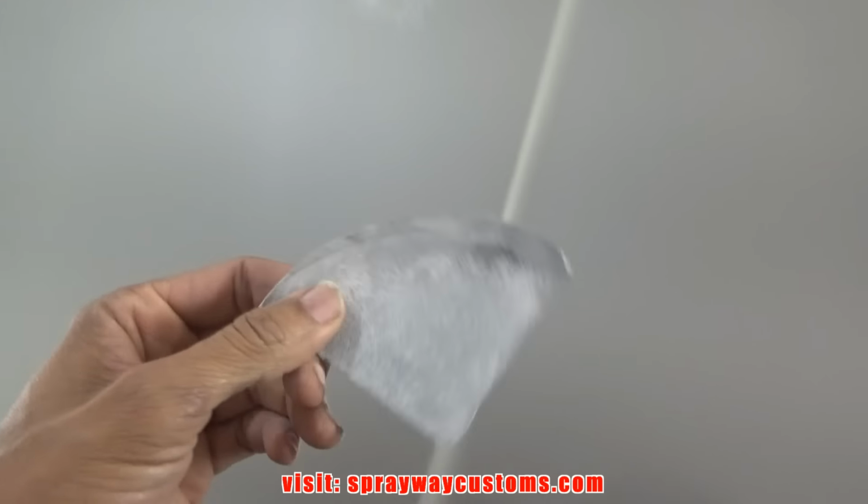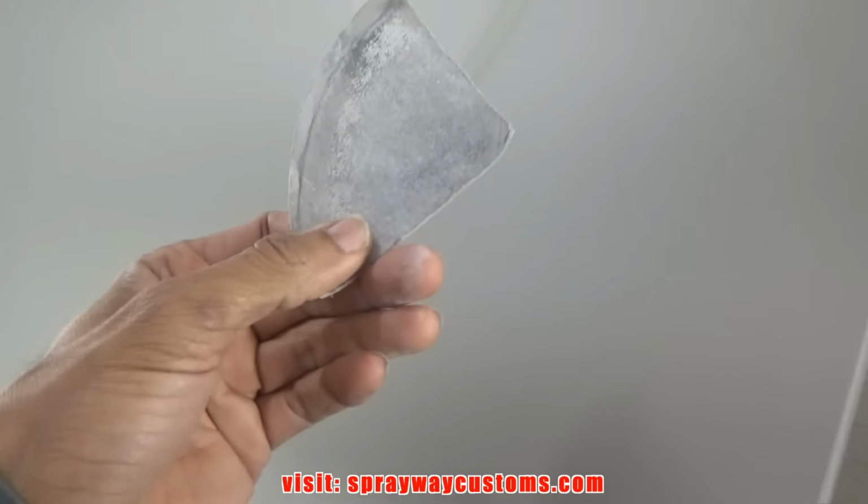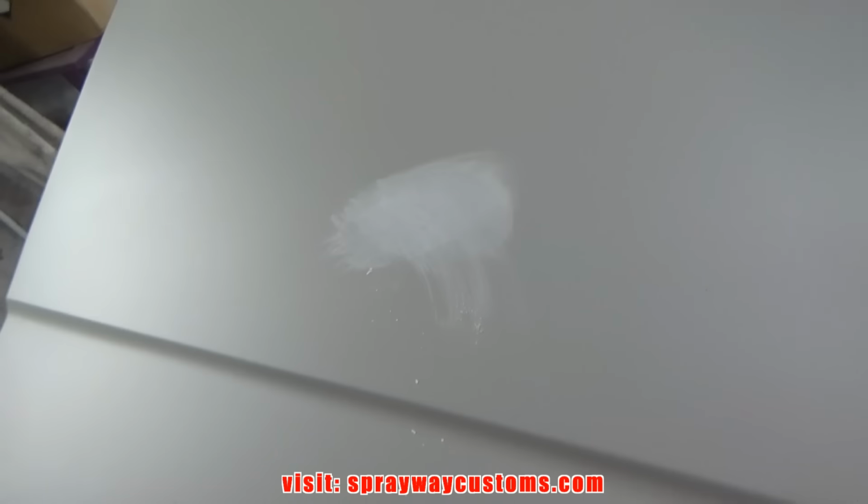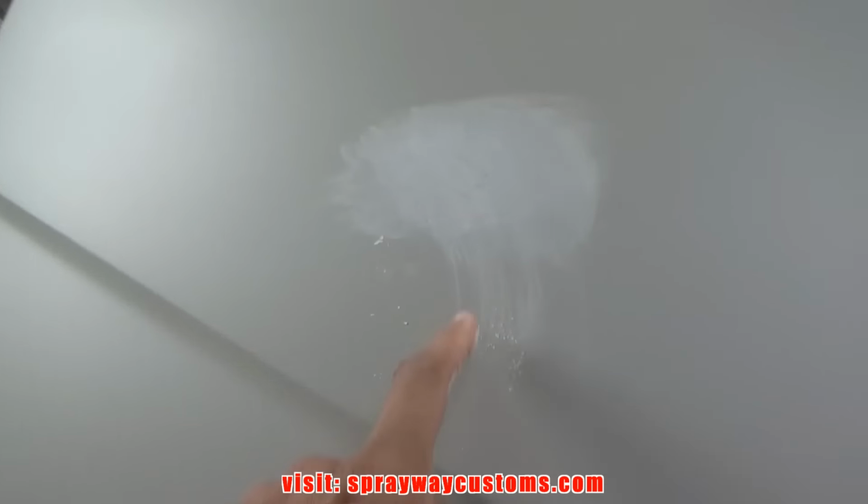All the areas that I'm going to wipe with glazing putty, I just took some 180 and went over the top of the spot that I'm going to wipe, just to give the filler something to bond to. It'll bond a lot better scuffing it up. Like here. Let me show you over here. And this is the push out I was talking about here. Just take my body hammer, this in here, and just knock it down. I'm thinking I knocked it down far enough. If not, we'll find out once we put the filler on and start blocking it.